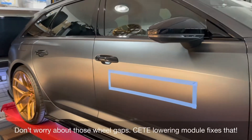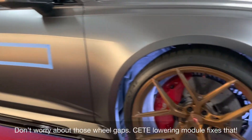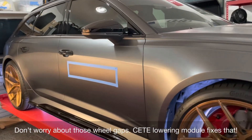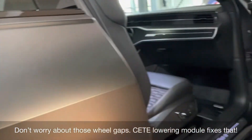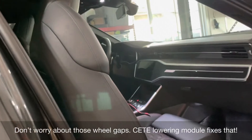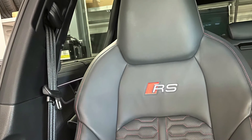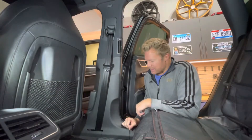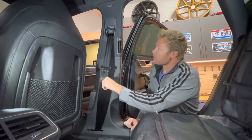This is my car up on the four-post lift. These are some Vossen forged wheels I put on — this is an amazing car, love this car — just want some red seatbelts. One thing I'd recommend of course is moving the front seat all the way forward to give you better access to these panels. Then we're going to start taking the trim off. This is the next day, and we're going to tackle this trim removal and removal of the black belt.